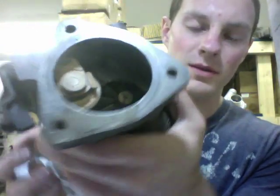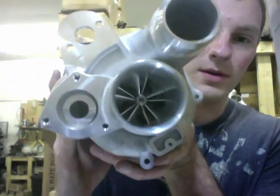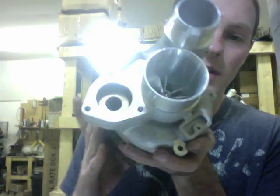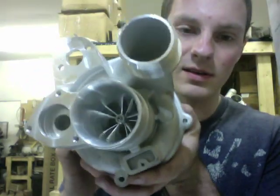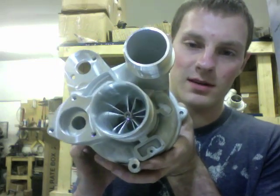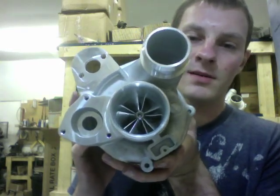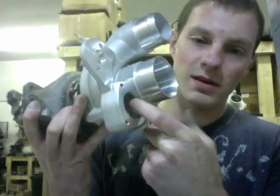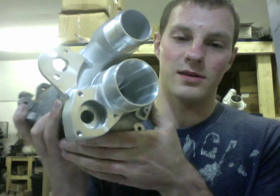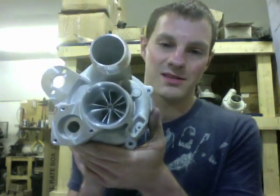Here's what the turbo looks like with the shaft upgrade, and here's the compressor side. For this turbo, I actually designed the housing to eliminate the blow-off valve, so it's more of an aftermarket piece for somebody trying to make more horsepower. You would just insert your old blow-off valve right there. However, you could cut that — or I could cut that for you — so that it's divided again, but I wasn't sure how pretty that would look.